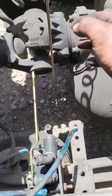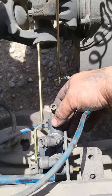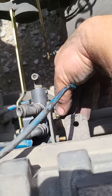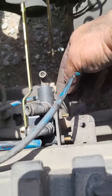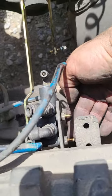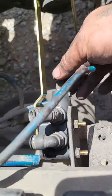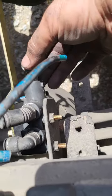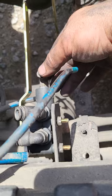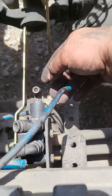Back to the point: as I was putting this new leveling valve in here, I noticed that this bolt here — this stud that comes out of the back of the leveling valve — the hole that it goes into closest to the drive shaft is slotted. The rear is not, but this one is. That allows you to actually move this leveling valve up and down, and that'll move at least half inch to five-eighths of an inch, which will give you a sufficient amount to raise or lower your suspension — whatever you need to do to get that driveline straight again and try to get that vibration and shaking out.